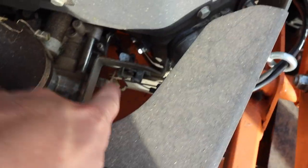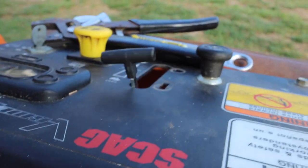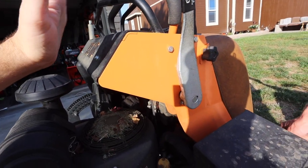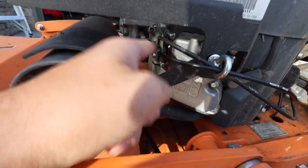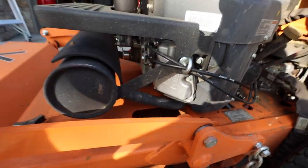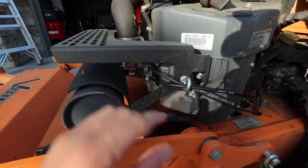Basically, there are little weird hooks on the end of these throttle cables. You put it in, then kind of bend it and it just attaches, and then we're just feeding it through the eyelets again all the way back up. Then take this, angle it, pop it up, and screw it back in. You're gonna need to adjust the throttle cable a little bit — when Tyler was doing it, it was going up really easy but going down hard and wouldn't stay all the way down. So I loosened this up, had him put the throttle all the way down, and this black part will slide back. Then just tighten it in that position, and it should work how it's supposed to.